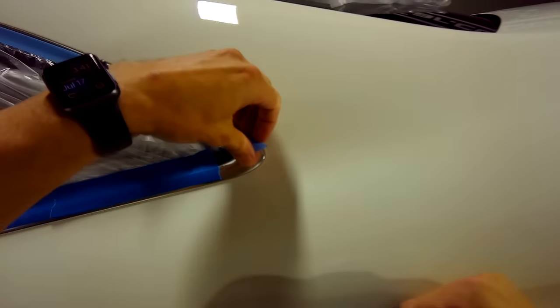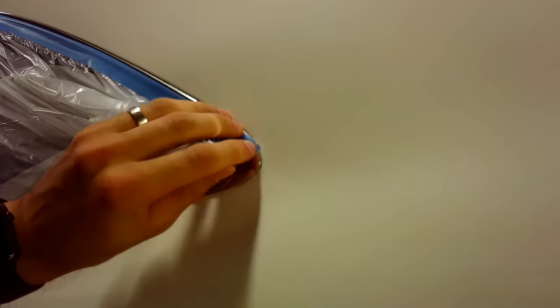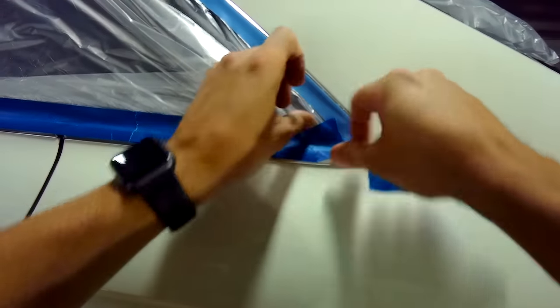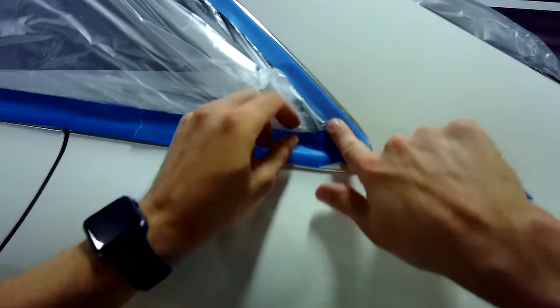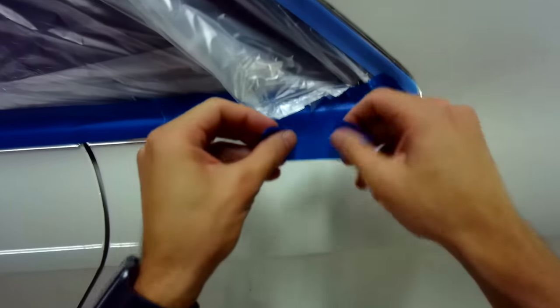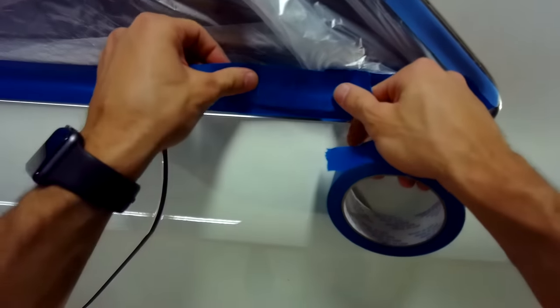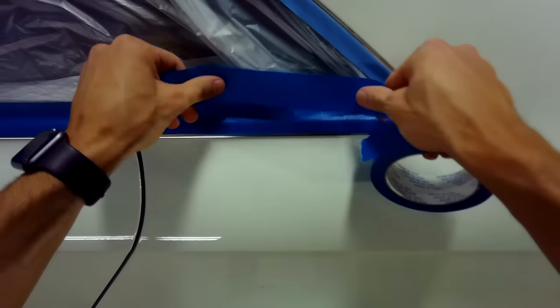You see how this edge of the tape and drape is kind of overlapping and touching the edge of the car — you want to make sure you don't have anything like that going on. Nice and clean all the way around. We'll use the yellow to edge that off. Make sure all the plastic is sealed off so that overspray doesn't get in anywhere. It can be very sneaky — even if you think it's completely sealed off, if there's a little crack left over, it'll make its way in there.